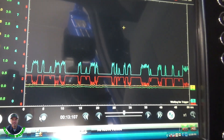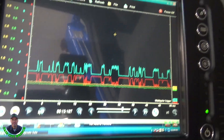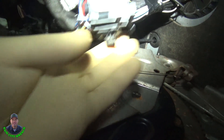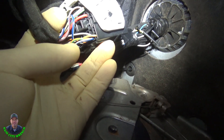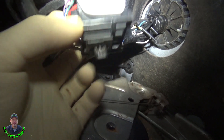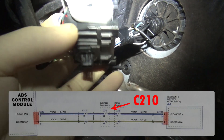It's kind of nice to catch it while you've got the scope hooked up. Now I've got to repair it. You can see my high-speed network is still going. I've got this main connector down here disconnected, so obviously it doesn't go through there — but the ones I'm looking for that are affected is that closed network.